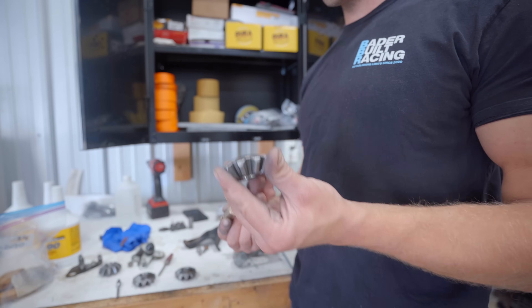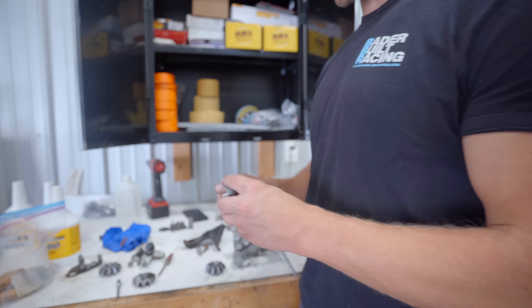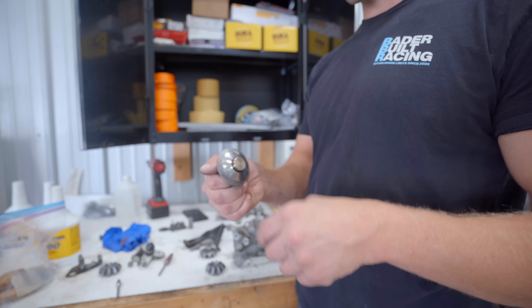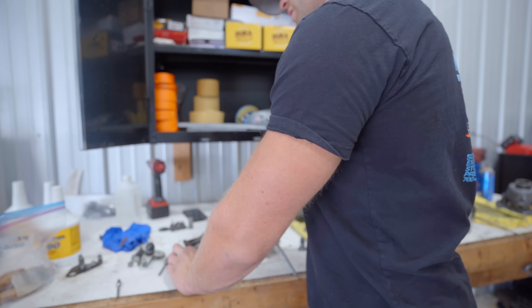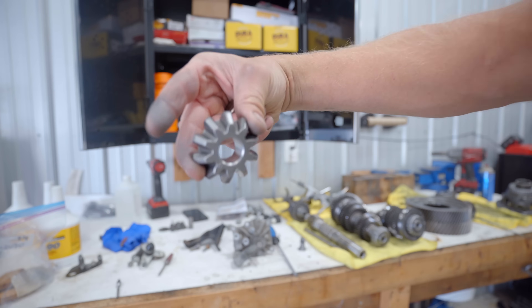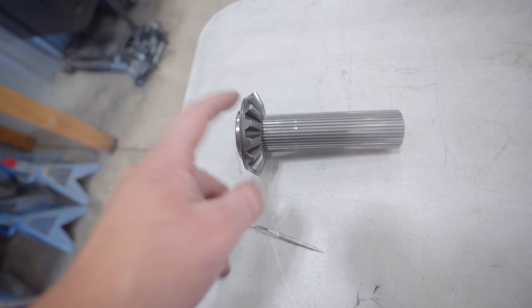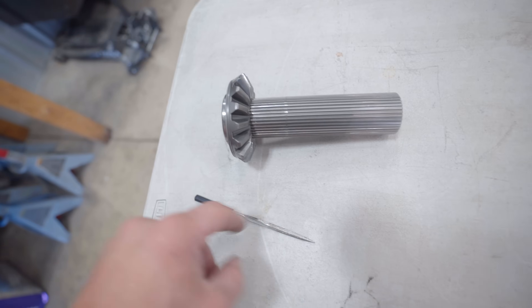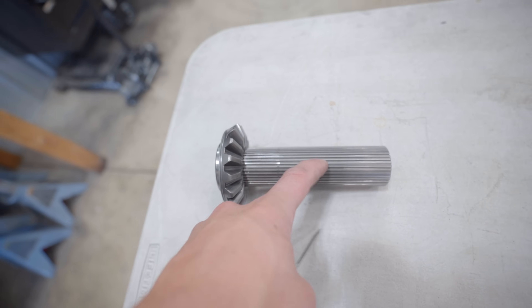Here's new pin and gear number one — brand new, not loose, not tight. Gear two, gear three — keep in mind this is without any lube — gear four. A little bit of polishing action and our gears are refurbished and good to go. The last thing we need to fix before the center differential goes back together is the splines on this shaft. I'm going to grab a little file, pull off the high spots and nicks inside the splines, get that cleaned up, and the whole diff can go back together.